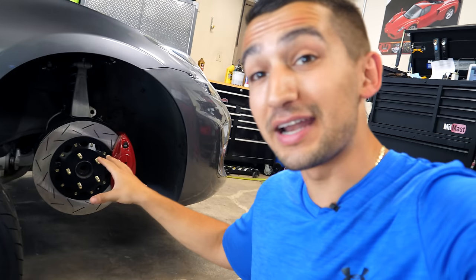After switching to these two-piece brake rotors front and back, combined with the super-light NKR 05 wheels and tires, I was able to shave 28.8 pounds per axle — 28.8 up front and 28.8 in the rear. There's a slight weight difference between the rear and front wheels; a full breakdown is in the description. Stay tuned — I'll be taking the car out for a brake test to compare before and after. Parts links and fluid info are all in the description box. A fluid change video is coming next, so subscribe to catch that. Thanks for watching, see you in the next one!